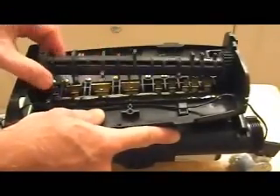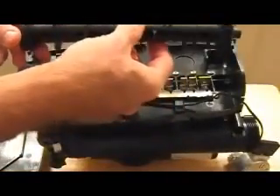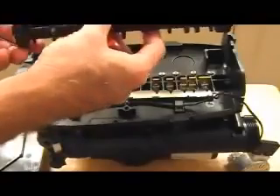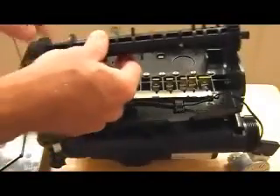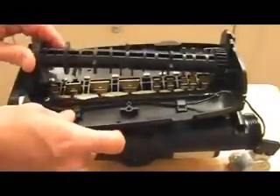Just remember, there's actually a top to the camshaft. There's an arrow right here — that's the top. Get that arrow pointing to the arrow on the valve and everything will be a little bit easier.